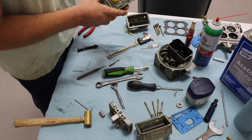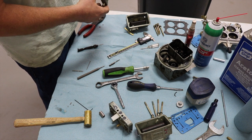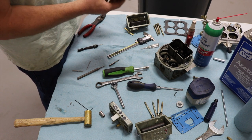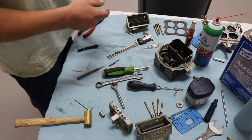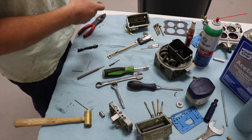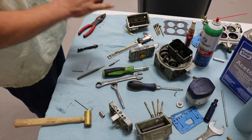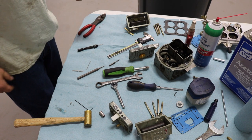This thing can go back together — I'll put the base plate back on with a new gasket, and these are going back together with old gaskets because it's going to come right back apart. The jetting was good. Adding the turbo, taking some timing out, and adding the exhaust will richen it up a little bit. We're going to see how bad it is — hopefully I'll have it on the dyno tonight, and you guys will see the results in about a month.